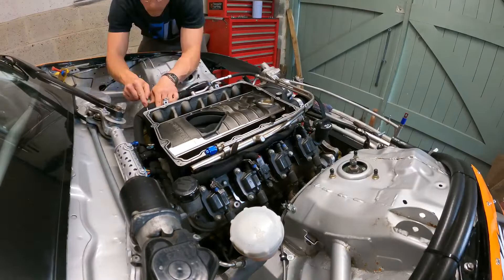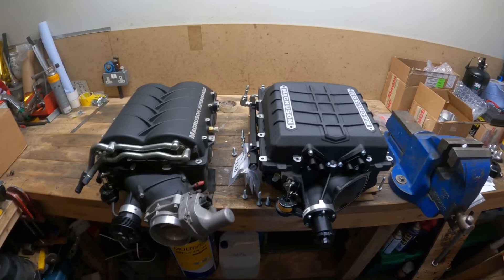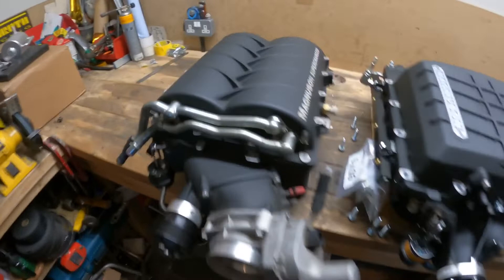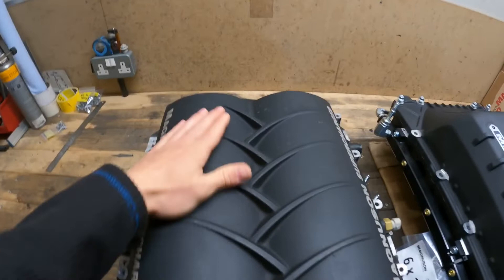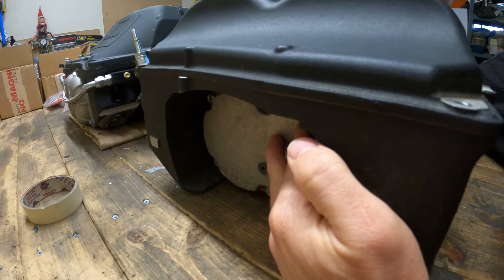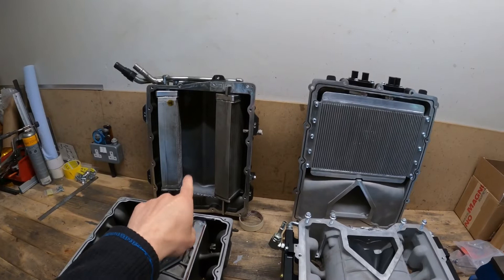Here they are side by side — Heartbeat on the left, Magnum PI on the right. We can start to appreciate the size difference between the two. The Heartbeat has a nice flat top and a different internal design. You can see the two Eaton supercharger rotors are tucked in on the Heartbeat, but on the Magnum PI they stick out at the back, which is part of why I'm concerned about the wiring for my particular install. We've got the lids off both chargers now and you can really see the height difference.